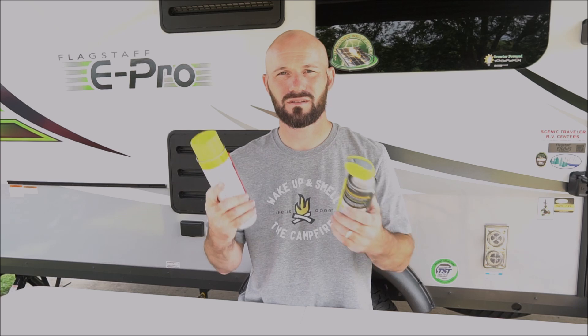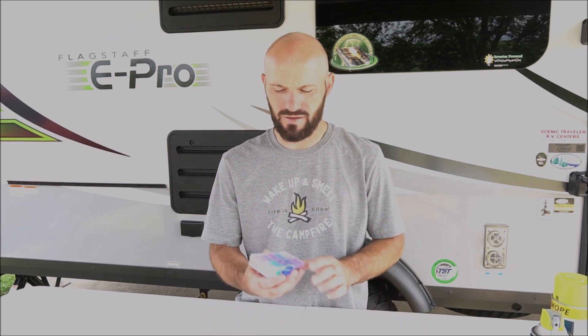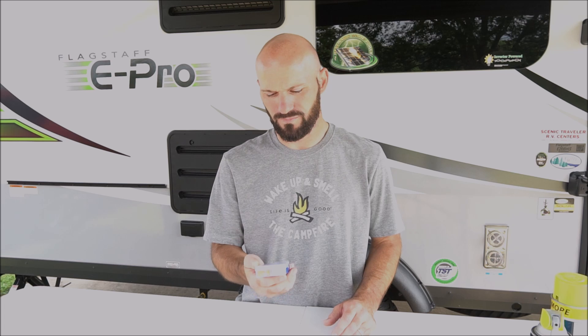Typically I don't bring these with us when we camp — I keep them in our garage. When we load up the camper to go camping we generally open the slide out, and that's the time I'll do it, usually every other week. Another item that you should have is extra fuses. I had a hard time finding the exact fuse set needed for our camper, so I ended up with more than I actually needed — but just make sure you have some 15s, 30s, and 40 amps.